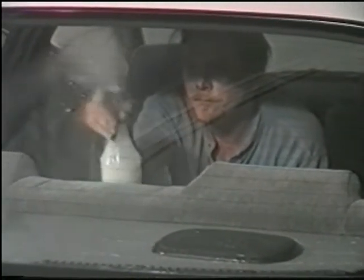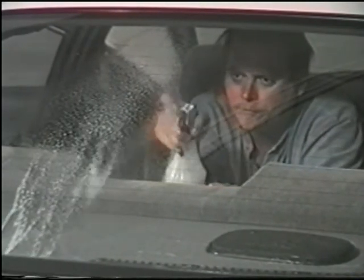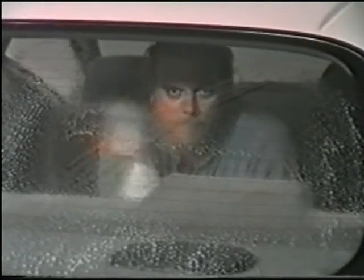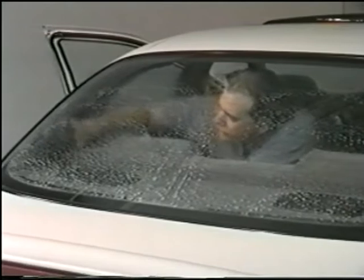Before installing the film, again, spray the window with soapy solution. Begin this process in the center of the window and spray side to side. Never spray the very top edge of the window. This could bring contaminants onto the glass from the headliner or the rubber gaskets at the top. Again, with your dry towel, wipe all moisture from the quarter panels. Now you're ready for installation.